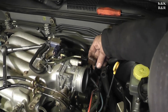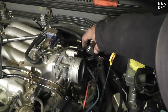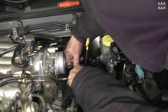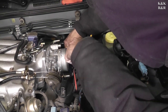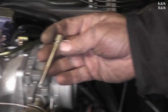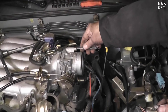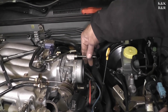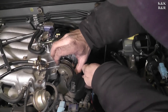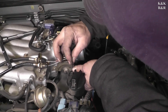Now let's undo these connectors. The darker brown goes up top, and the light gray goes on the bottom. That almost worked better than anything I've tried so far. So that's what you're trying to get out. The last bolt I already broke loose and left it in there, so it makes it easy. Did you see it starting to come down? I'm going to take off the throttle and cruise control cable for now, just to see if it'll free me up a little bit more room so I can squeeze everything past.